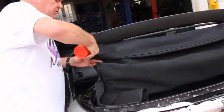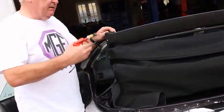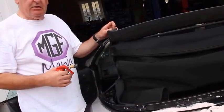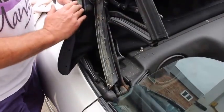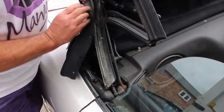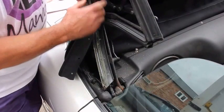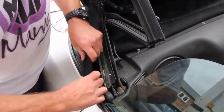onto the corner of the hood. Again, the same procedure: we allow this to dry, then we reactivate the old glue on the hood. Okay. Right, and now that the glue is tacked off on both of the surfaces, we fit this B pillar, making sure that the plastic substrate is tucked over the metal edge, all the way down to the bottom corner.